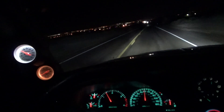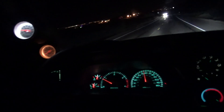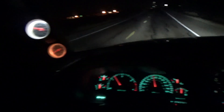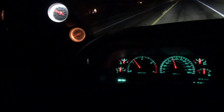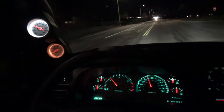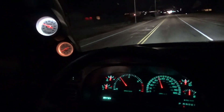Overall I'm happy with the truck. This is a good bolt-on, affordable upgrade for a budget semi-quick truck. It'll probably make 750 foot-pounds of torque give or take with this stock turbo and a tuner. It's mostly just balancing your EGTs — that's why people go bigger turbos. Mine are okay and honestly I don't really need to floor it towing or going uphill — the truck has enough power to do it. I don't think I'll ever max out EGTs because that was a hard pull. So, get this truck back home and I'll do a review or just close out the video.